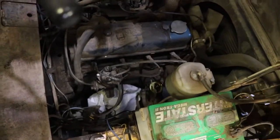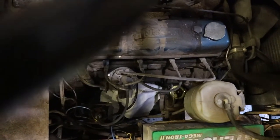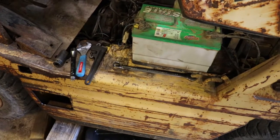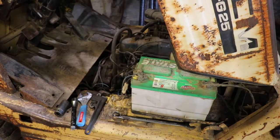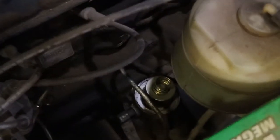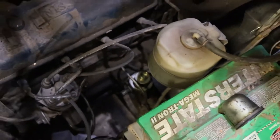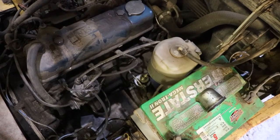You can see the fuel bowl there. There's a little fuel tap you can use to turn off the gasoline before you crack that open, so it's pretty easy to work on. The filter — it looked like I had the spring in the wrong position initially. There doesn't appear to be a drain for that cavity, so I cleaned it out with a cloth. There's a bit of residue in it. Also there's the fuel pump right there — it's a mechanical pump.